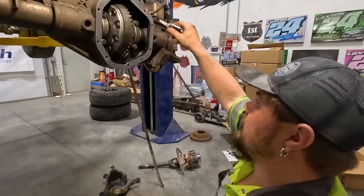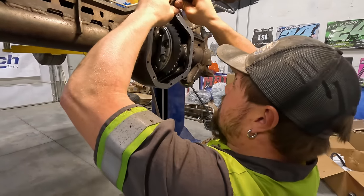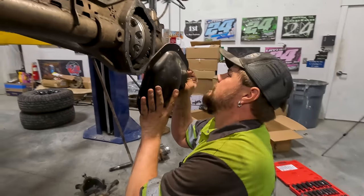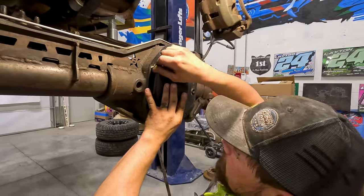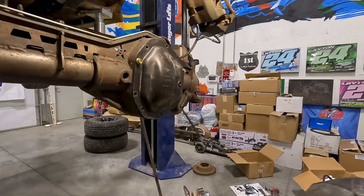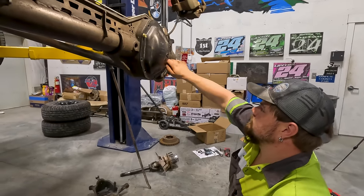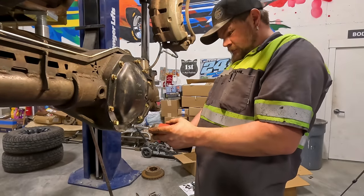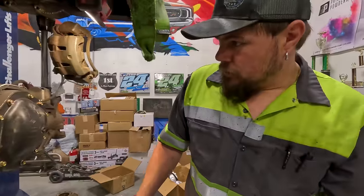I want to put this RTV on extremely thick because it was still leaking out of the bottom a little bit and I don't know why — it was gasket-makered and it's a paper gasket, so I'm just going to put this on thick. Time to put the cover on. I think I know why it started leaking — me and Colton just gasket-makered it and cranked the bolts down. I've always been taught to snug it up until it barely starts to come out, let it dry, and then tighten it up. We didn't do that. Let it harden up and then go back through and tighten them to where they need to be.